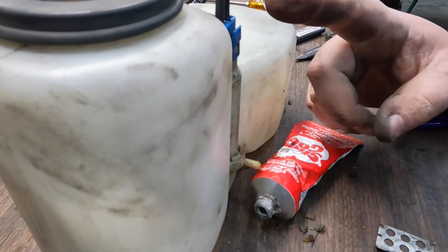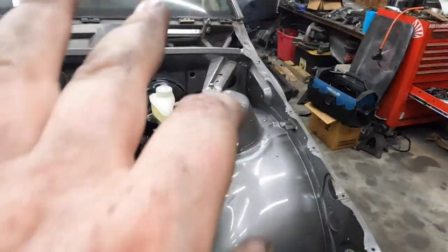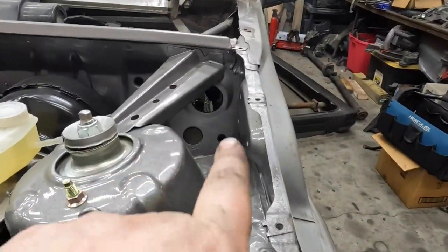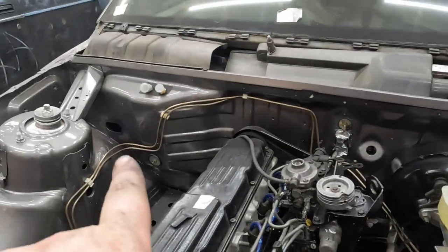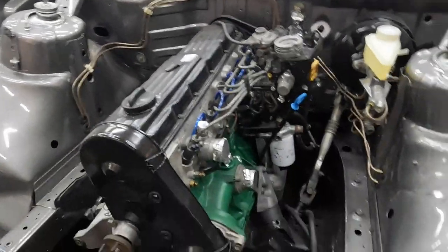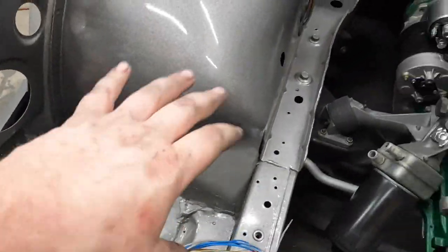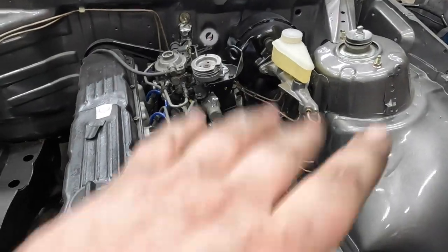With a few more to do like that, we'll start putting wires back in the car. With all the obvious problems cleaned up, ready to lay them back in. Just going to feed them through the feed-throughs and drape them around roughly where they need to go. There's only three feed-throughs. One thing I forgot to mention: when you're taking that conduit off, put a zip tie anywhere there's a branch — that way you know where those are for putting it back in more cleanly.